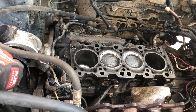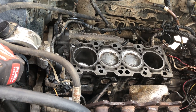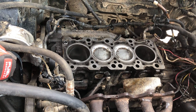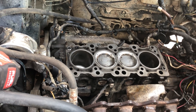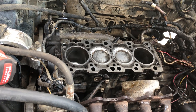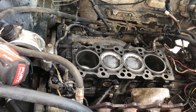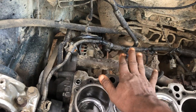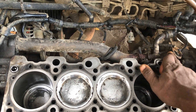It's a good trade — a good skill to have, auto mechanics. When you're changing the cylinder head, it's best to also change your timing belt, the balancing shaft belt, all the belts — just change them. Change the crankshaft seal, front and back. Change what needs to be changed while you're in there already. This coolant pipe right here needs to be replaced because it's rusted and deteriorated — all heated up. I noticed they had put a lot of epoxy around it, but I got rid of it and now I need to replace it.